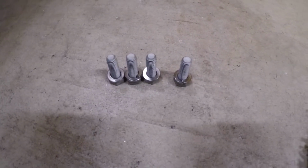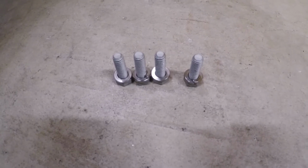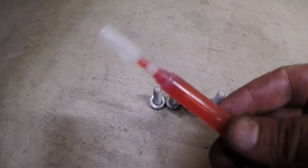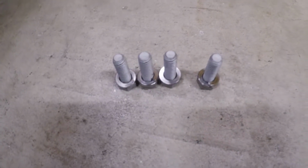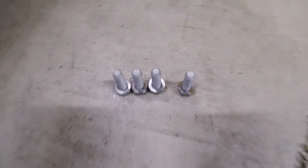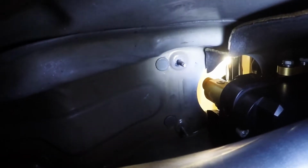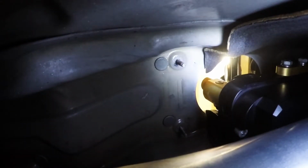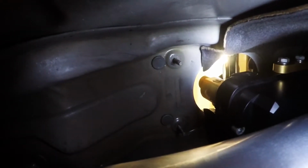Okay, I got the arms bolted up to the transmission. We got four bolts that go from the other side of the arms into the shifter unit. We got some red Loctite from MGW. Just put some Loctite on those. Those are 13 millimeter bolt heads, and those go into the side of the shifter assembly. So the arms are bolted on the shifter. Basically, the last thing to do is to do the mount on those two studs coming out there. That's where you're gonna do your solid mount. And then everything is basically just finishing up the top plate within the car.